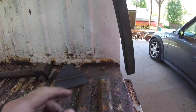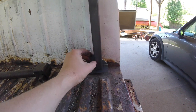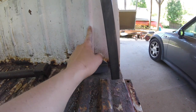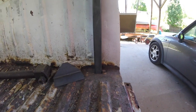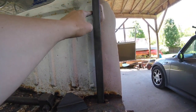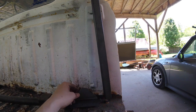A little divot there that bumps out. A little bump out there. And I do think that this pipe needs to go to the outside of the cab divot, and then I'll weld a plate, weld a piece up here to pick up that bolt. Sorry, took in too much metal on that last cut.